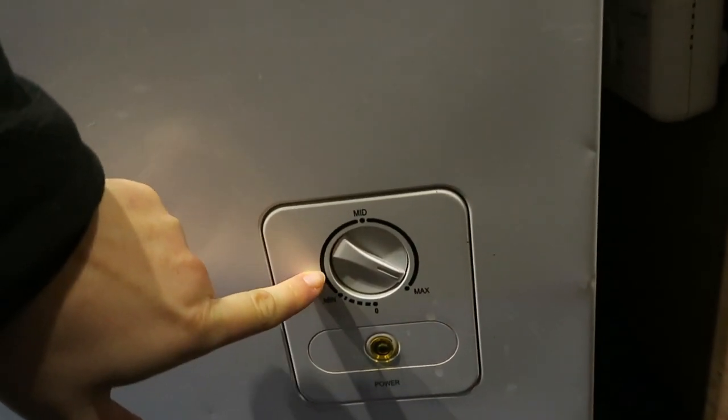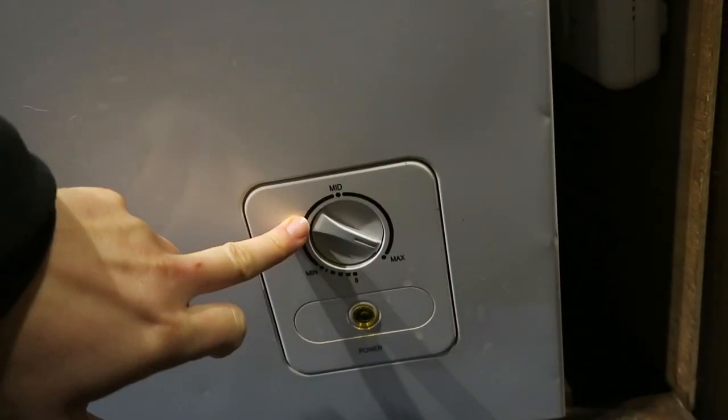It did not drain the battery as badly as the old fridge-freezer would have, but it still drove me crazy. There is a dial on the freezer to minimize or maximize the coldness, but there's no explanation of what temperature corresponds to minimum, middle, or max — and no explanation online either. I had to figure it out myself: if the freezer is minimally full, it needs to go on minimum; medium full, medium; and if it's completely full, it needs to go on max.